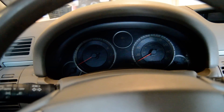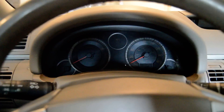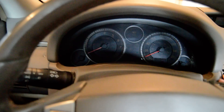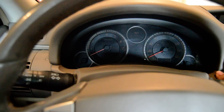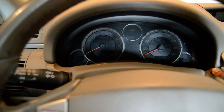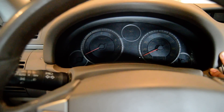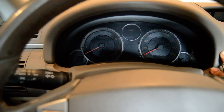What you want to do is make sure your engine is off — car is off. You want to not be touching the gas pedal, because we're going to be pressing it in a second. Turn the key to the ignition position but don't start the car. My car has a clutch so I can't start it without pushing in the clutch. Just put it in ignition and wait three seconds. Then press the gas pedal all the way to the floor and release — do that five times.